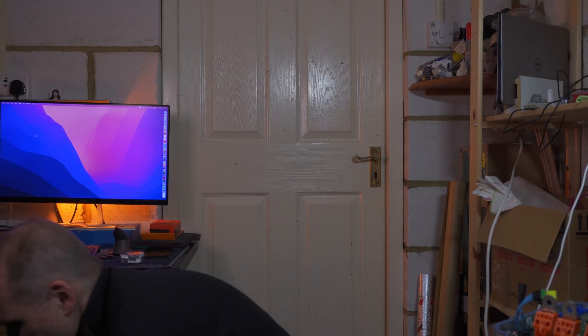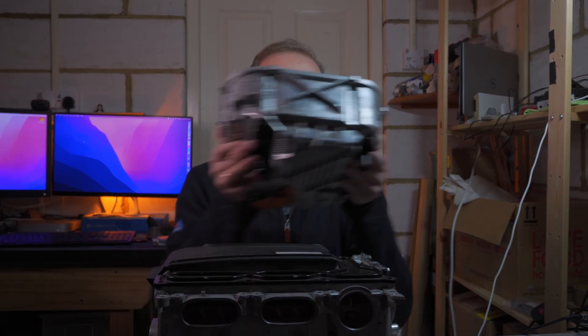Let's compare this with the Toyota Prius inverter. I'm even struggling to lift it up — so this is the Prius inverter in comparison, only capable of 50 kW max. Compare this with Tesla, capable of 250 kW peak power. To be totally objective, the Prius inverter has two inverters inside, with two connections for two motors — MG1 and MG2 — as well as a DC-to-DC converter. But still, 50 kW max peak power here versus 250 kW max peak power in the Tesla.